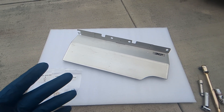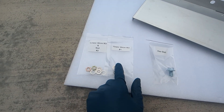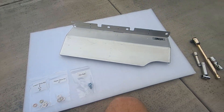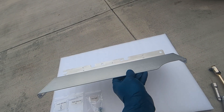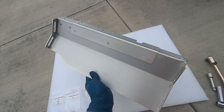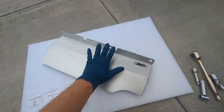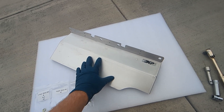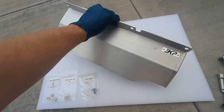What comes in the package will be the heat shield itself, a hex bolt for mounting, some shims required, and then some nuts that will mate with that. This is made out of 5052 aluminum, which is really good for corrosive resistance and cost. It is also lightweight. This is a pretty sturdy heat shield because I really want to minimize any flex. This is a cantilevered design — it mounts on this flange up here and everything hangs off the end. Stiffness was really in mind with choosing the thickness of the material and the riveted gusset design.